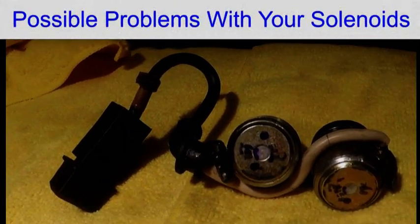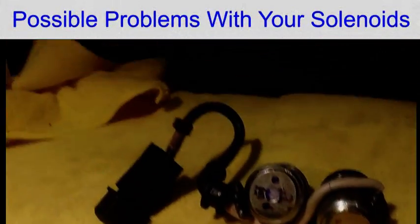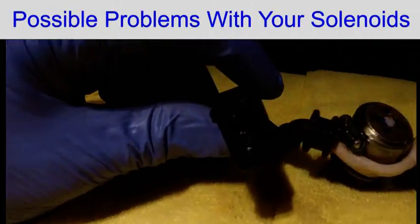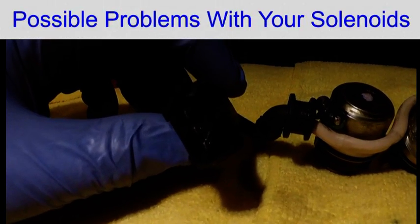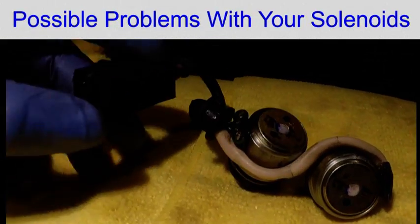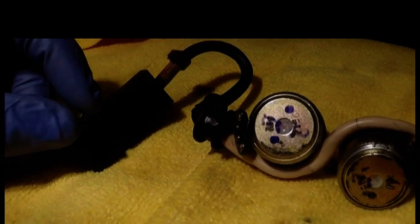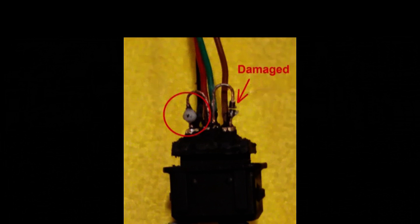Having a quick look at the solenoids — these are the inlet solenoids. You can tell that because of the short wire and the number one on the cable. Each cable has three prongs. The centre prong is a common zero volts. One of the outer prongs goes to one solenoid and the other outer prong goes to the other solenoid. Inside the plug there are also some Sinterglass flyback diodes which I had to replace in mine.